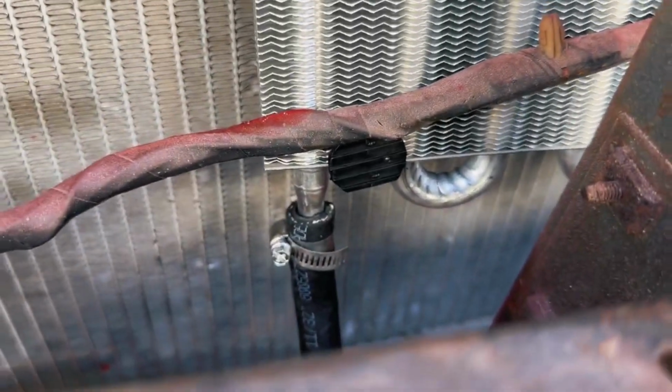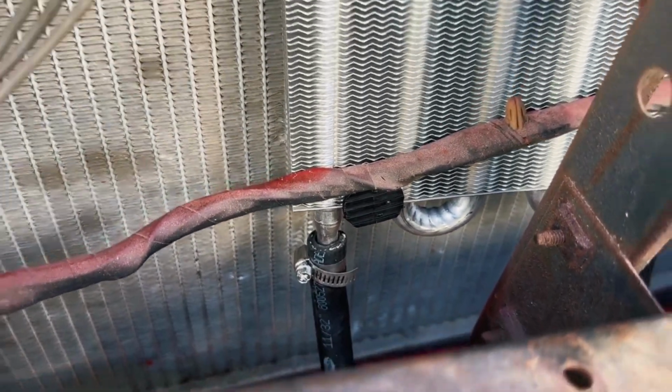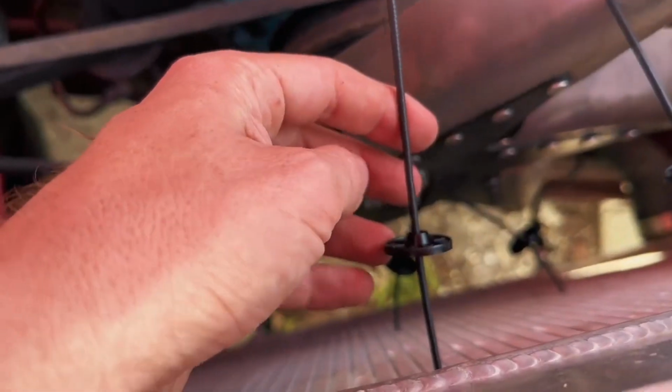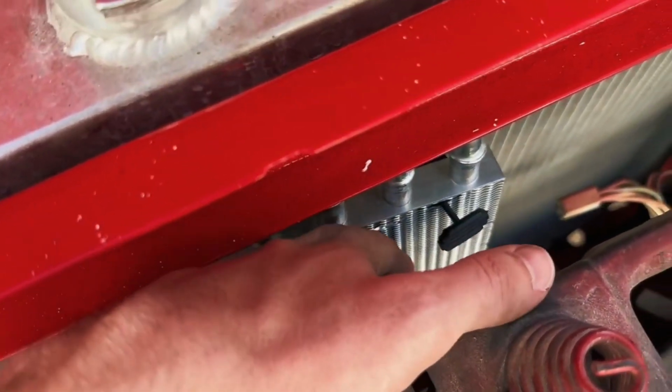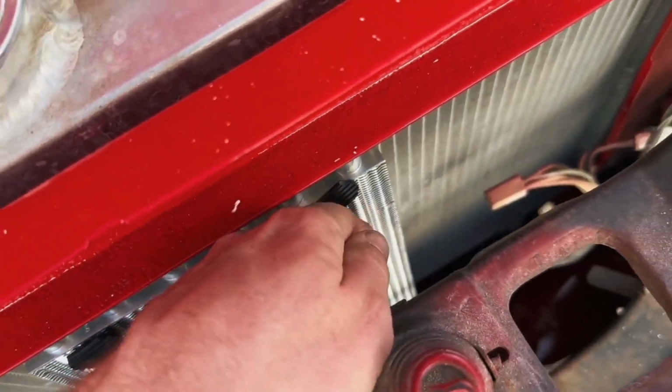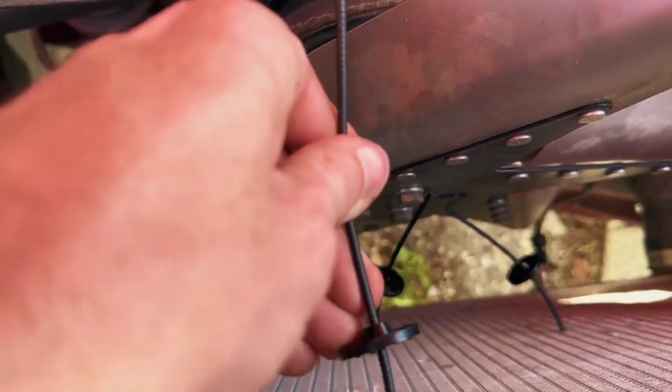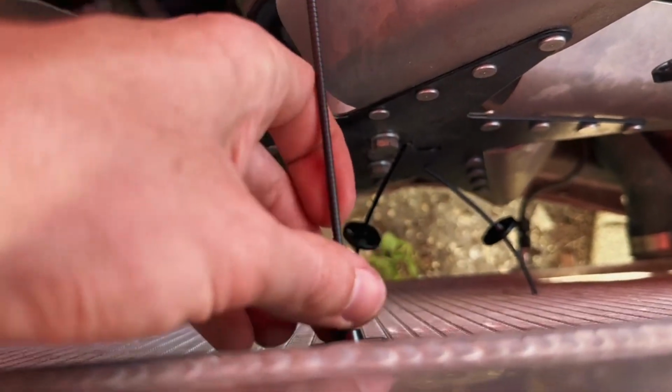All right, so hoses are connected, and I guess at this point we just need to tighten up the connections that mount the actual cooler itself, and we're pretty much there. So I got my clamps on down there, and we got our clamps on under here. Normally I would spend a little time and try and go better than this if I was keeping all of this, but that should be good enough. So I have slipped these guys over, and basically I'm just gonna press the cooler back up against the radiator like so. And then we're going to slide these into place.